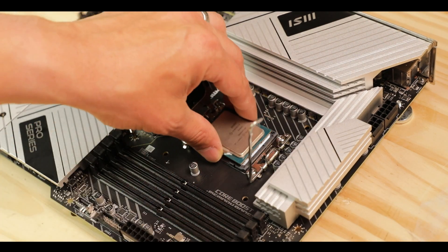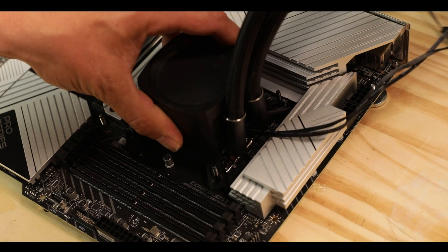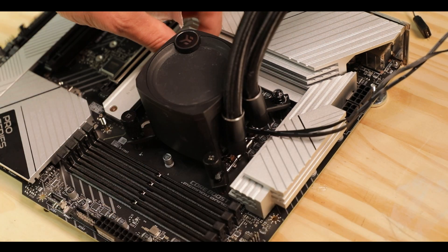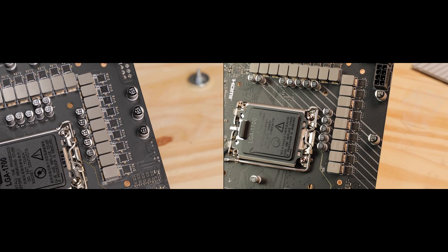These results were achieved at stock clock with an i9-14900K. If you go and overclock it, you will cross some threatening temperature limits, which leads me to say that despite having an overclocking-worthy VRM, the cooling blocks are simply not good enough for higher-grade overclocking configurations. A copper pipe linking both blocks for more homogeneous heat spread would have helped, but that's another discussion. Despite some limitations, I still see this VRM as a major improvement over cheaper Pro siblings, and I can see this motherboard touring with K-class i7 and i9 processors alike.